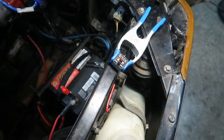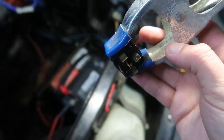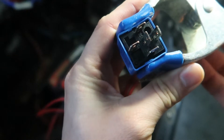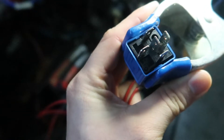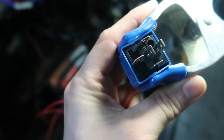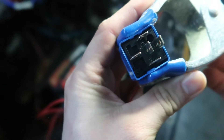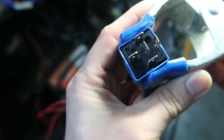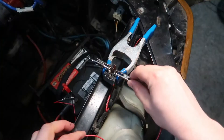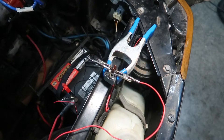I'm going to put battery negative onto post number 85 — on the relay it'll show which terminal is which. You can see on this one it's labeled 86, and then there's the little 85 on this one. That's what I'm attaching the jumpers to, and battery positive to 86. Now it does click on, so that part still works.